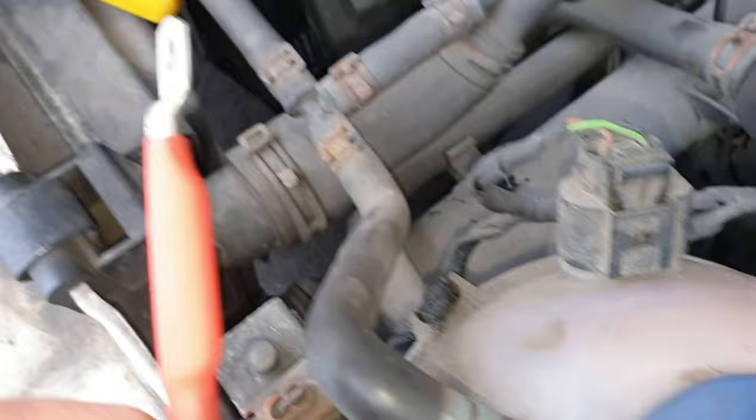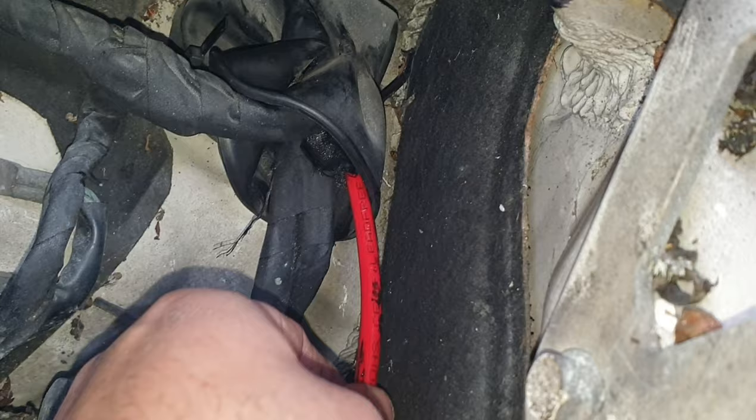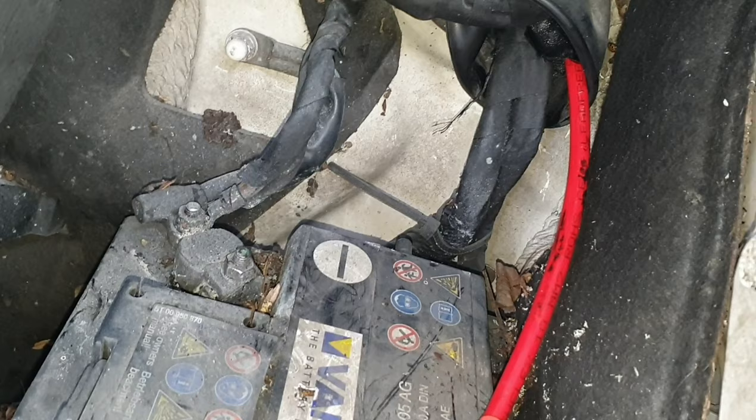So from the battery into the first fuse. I'll tighten it up, pull it through a bit, and it can sit just under there — keep it nice and dry. So from that first fuse we now go inside into the split charge relay.